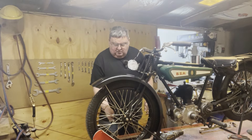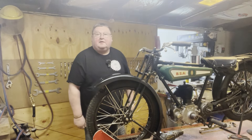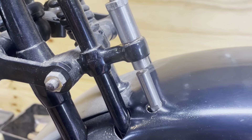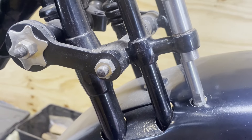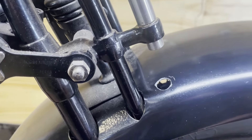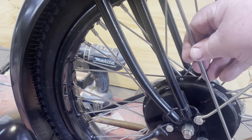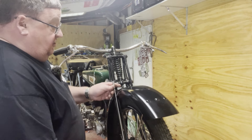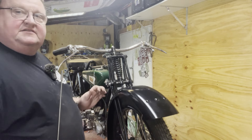Bear with me, I'm going to take a few parts off and then we'll have a look at this together - I might actually have to get your opinion on whether what I'm thinking of doing is a good idea. So there's the mechanism and there's the hole. I was going to try and get that through there but it doesn't go in properly. I don't know whether I've got the hole in the wrong place, but that doesn't work - I can't get past the guard stay with a straight rod. Not working. I believe I have the hole too far over in the guard - I think the guard hole needs to come out a little bit and I'm going to have to get a die grinder and grind that out. This is going to end in disaster with a repainted front guard.